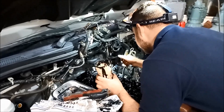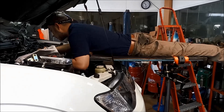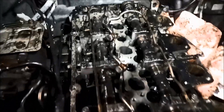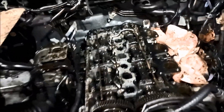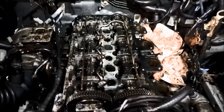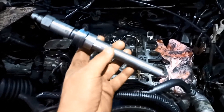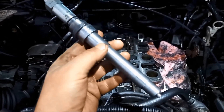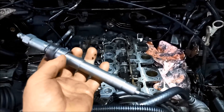Sludge. Now we've got all the injectors out. Steve-O did clean it up a bit, but all that oil and muck that's gone down into the cylinder has just blasted out again. I'll do a quick compression test just to see what we're getting. I've spun a dummy injector in there just so we can get a more accurate pressure reading on that piston.